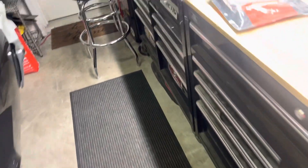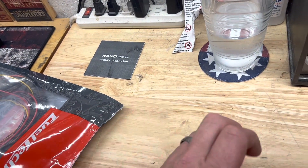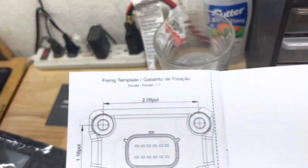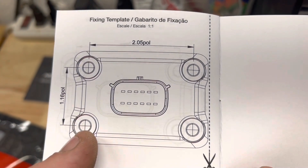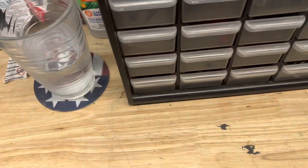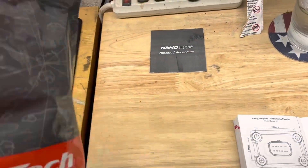The bump button is off and the cowl is partially removed — you can see the hole where the button used to come through. FuelTech, with everything they make, does something super cool that a lot of other companies do too, but it's a nice touch that makes it super user-friendly for guys doing installs: a template. Cut this page out, cut out the holes, mark with a Sharpie, drill some holes, and open up the button hole to fit the harness plug.